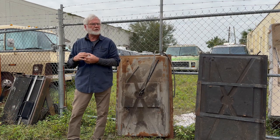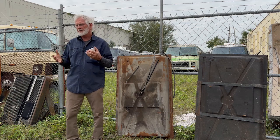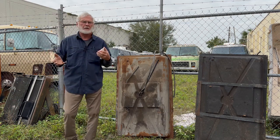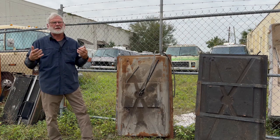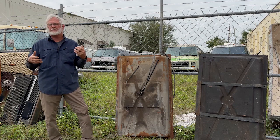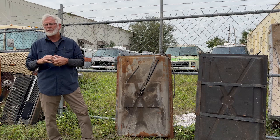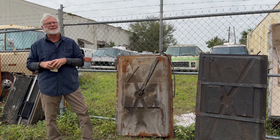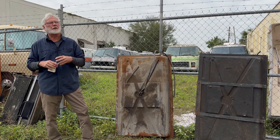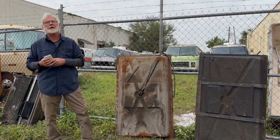All right, well look, I hope this is helpful. We had comments that come in on the last videos. One of the comments was about the alternator light system. Guy called, he texted in and he wanted to know, do you cut the wire or not? Can I just cut the wire and it goes away? Well, you could, but then the alternator won't work. Well, what do I do now? Go get a one-wire alternator.